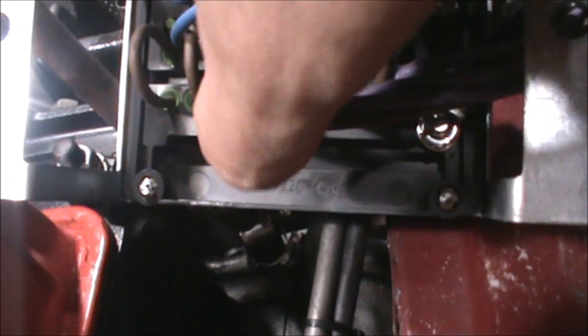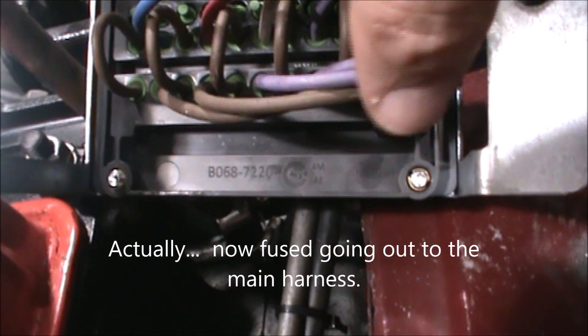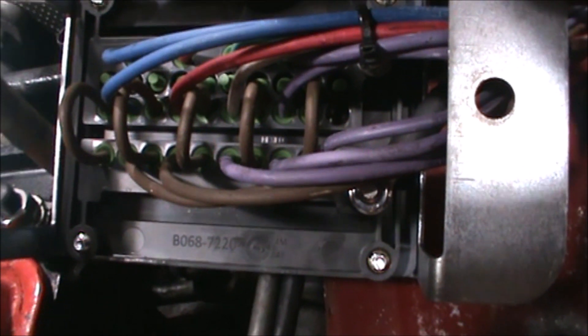Now I'll show you underneath the RTMR. I've got all the jumpers in here going from the bus positive side to the relays. You can also see the non-relay side — the browns are the unfused incoming circuits and the purples are the always-on fused circuits. I followed the color coding all the way through, and I'll post that on a PowerPoint slide included in the video.